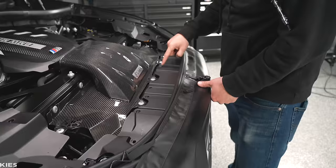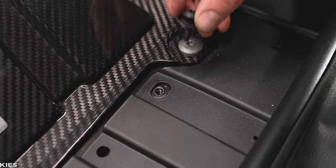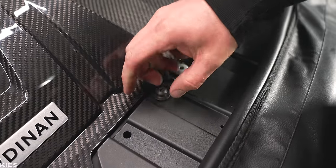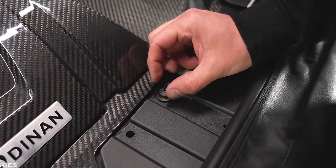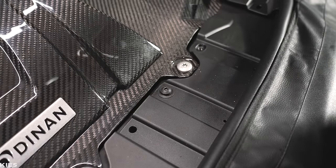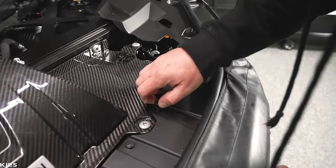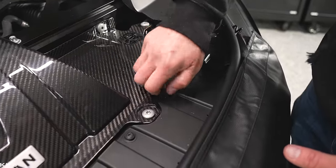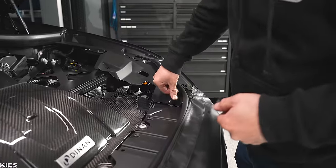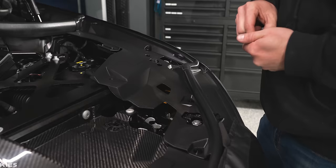Next, you have the four T30s. No matter how new the car is — and this car is brand new — you can see an outline of the bolt. What you want to do is just push the bumper in to make sure that it is perfectly seated like BMW had it from the factory. Snug that up and this one should pretty much fall into place. This is going to make sure that your hood alignment is perfect. Now reinstall all these fasteners and then we're going to reinstall that 13 mil.